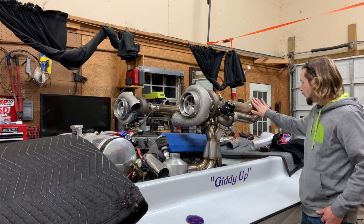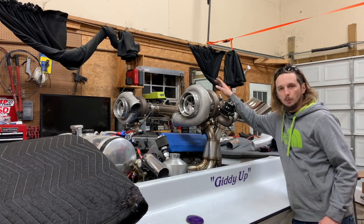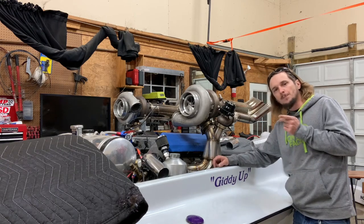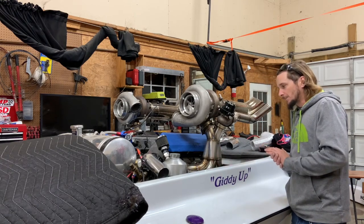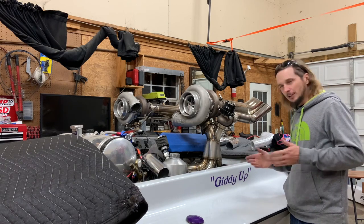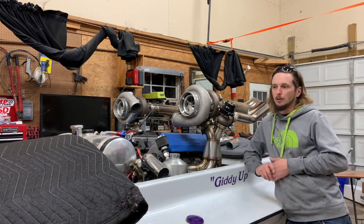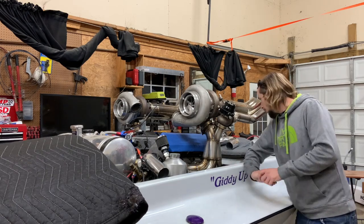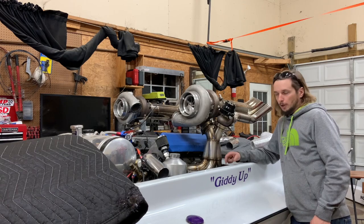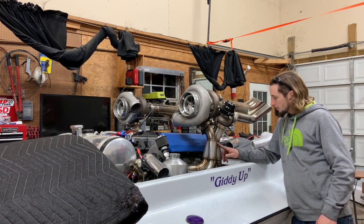We'll salvage this piece to match for the down pipes - still the same from before. We're converting it from carburetor to EFI. The intake manifold is that Wilson manifold right now getting bung'd. This boat has an air-water intercooler because lake water and river water is free - it's very abundant. When he told me that I'm just like, it's genius to run an air-water intercooler on these things. You think air-water intercooler and you think race car, ice box - but we pump lake water or river water through it, it stays cold all the time and it just works out great.